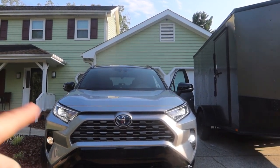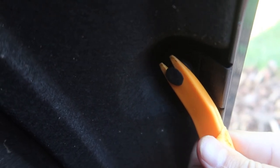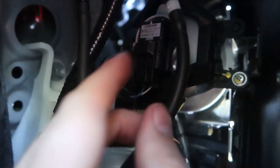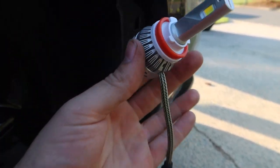We'll be filming some videos tonight to show you guys on the road what these new switchback lights look like. Now let's move to side number two. Turn the wheel the other way so we can get in there. On this side, right there is our clip that we need to remove — I'll take my tool, come up in here, dip underneath it and take it out. Now pull that plastic clip back, get in here, and pry out the fabric. Now we have access to our halogen that we're replacing with an LED. Push the bottom button on the clip to remove it, then turn the bulb to the right to remove it.